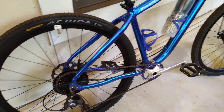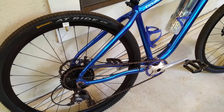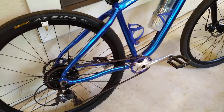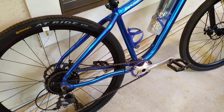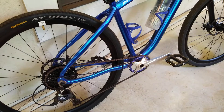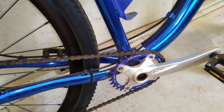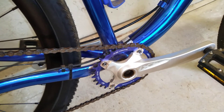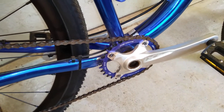This may or may not apply to the bikes you have. This was a one-by-nine from the get-go, but Hyper being a Walmart-branded bike, it had a low-grade stamped one-piece crank and a front chain ring with a creaky open-bearing bottom bracket — just terrible. So what I did was I went with a 32-tooth ring, keeping the same number of teeth so the gearing would remain unchanged, but I went ahead and got an IXF crank, which is kind of a Chinese version of the Hollowtech that you get from Shimano. That did absolutely great.